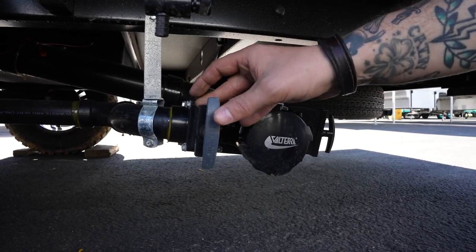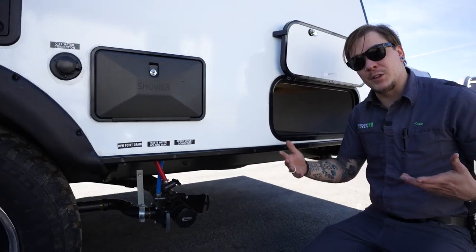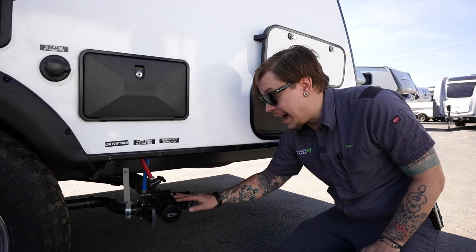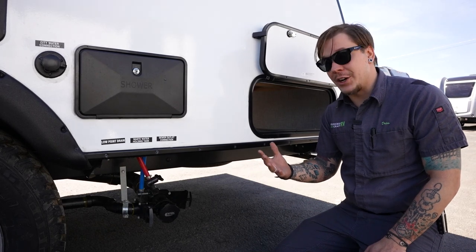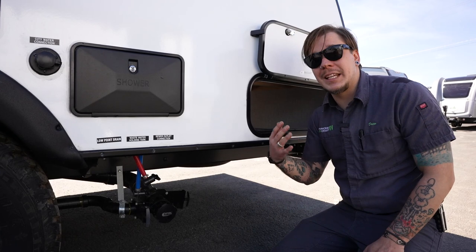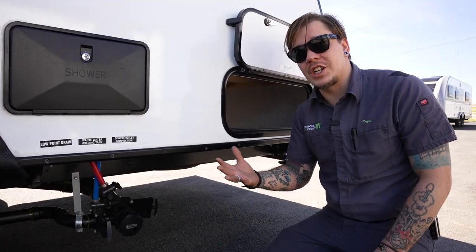Now it's very important that we do operate these properly. We want to avoid any cross-contamination or backfeeding between the two systems. It's very important that we keep these valves in the closed position. We're going to use the onboard monitor panel and we are only going to dump as necessary. That becomes especially important when we talk about that black water tank because we need to keep that solid body waste and that toilet paper in as wet and flowing condition as we can.